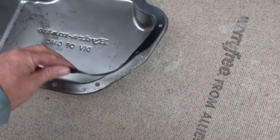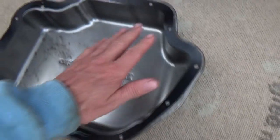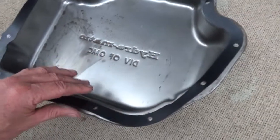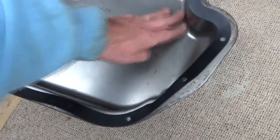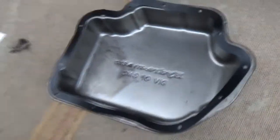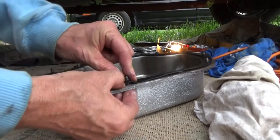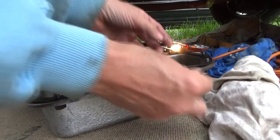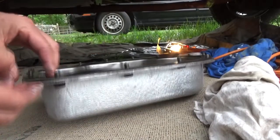We got the filter on, now putting the gasket on. The secret is to get it up there without cocking it — I don't want to do that because if that stuff gets in the transmission it'll ruin it. So now I'm setting all the bolts, pushing them right through just like that so the gasket stays on. I paint the bottom too — see that.